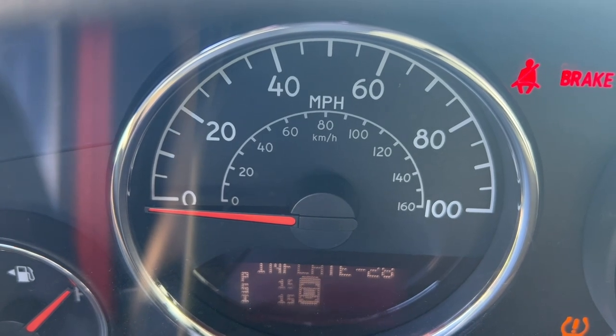And what's a beadlock? It's just a way that the rim holds the tire on so it doesn't slip off the bead. So how is that different from our tire to your tire? Well, yours doesn't have beadlocks. It pinches the bead on the tire and it won't let it slide off. Like if you guys got on an edge or something and you were low on air, then it could push off of the rim and you'd lose all the air out of your tire. And you won't, even if you went down to like 2? No, it should still stay on. Wow. So where are you at now? 15.